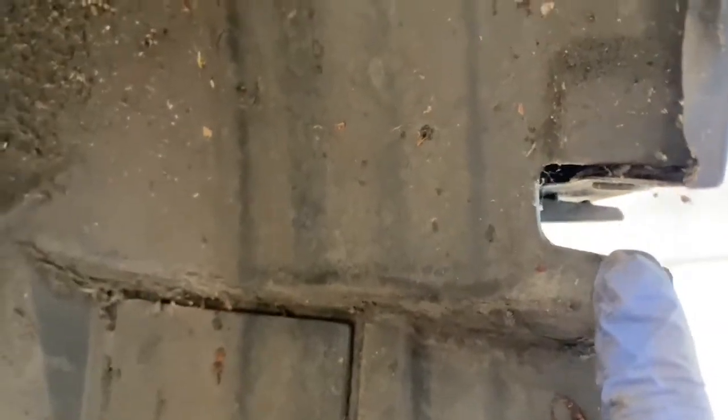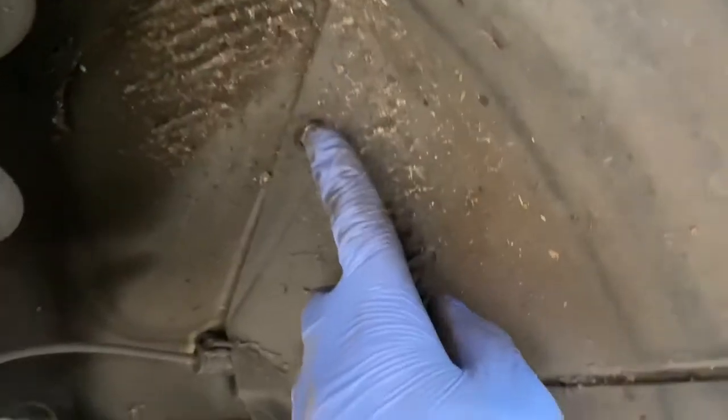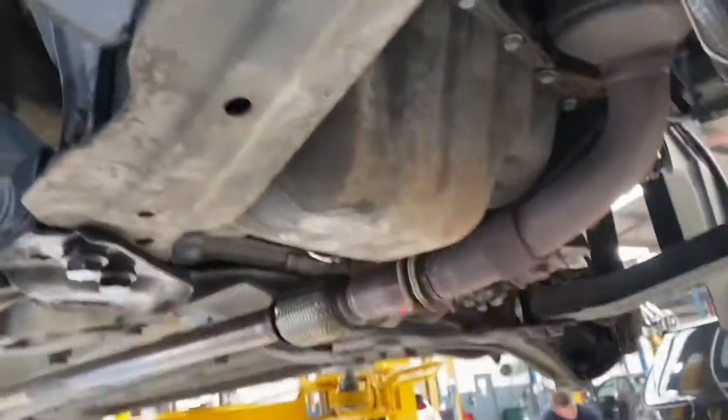As you can see, that's the front bumper on the floor. It's held on by T30 Torx bolts that literally bolt in there. There's one up here, and there's also a 10mm nut on that side and one on the other side, and literally another three T30 Torx bolts on top here to remove the bumper itself.